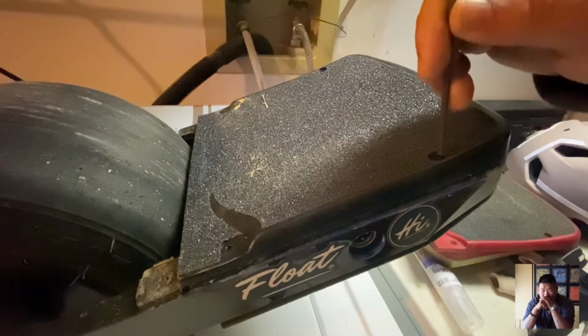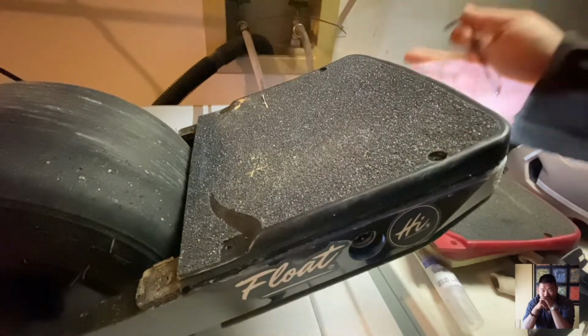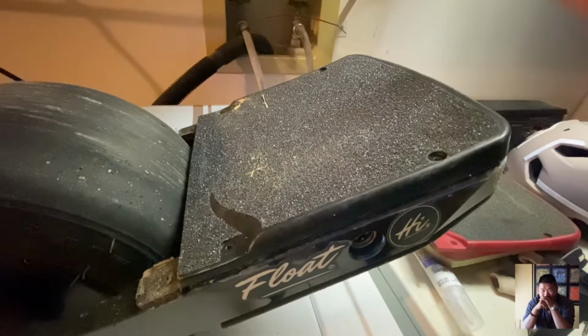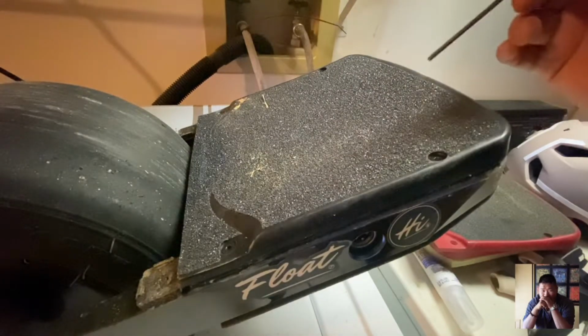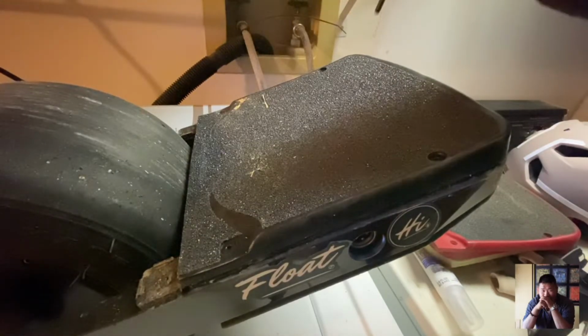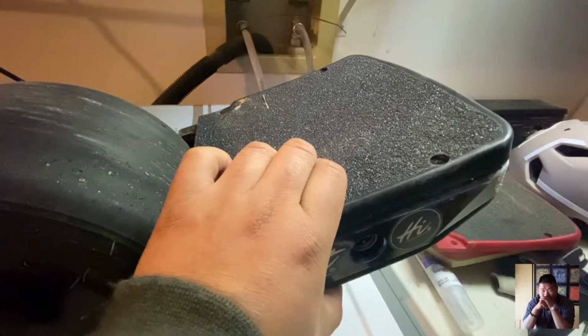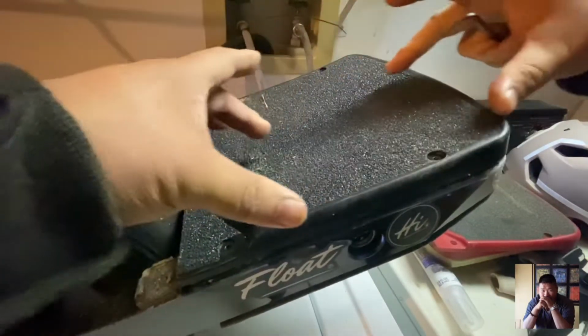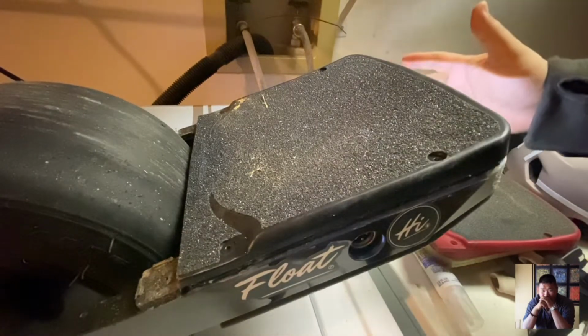Because what you'll see is that you may tighten these screws down, and in the app it may not register that the sensor is in contact. But if you watch the light, it will get brighter, saying there's contact. So I think the sensors are working on an inverted resistance logic or something. Right now there's infinite resistance because the circuit's open. But as you close it with just enough pressure, it closes the circuit enough and creates a higher amount of resistance than stomping on it with the full area of the sensor. So I think there's a variance in resistance, and based on the amount of resistance the board registers, it will vary between what the app reports and what lights up.